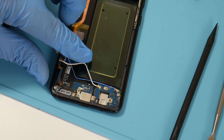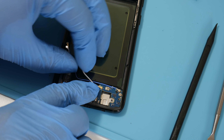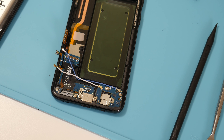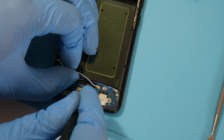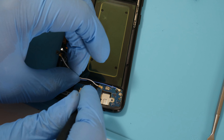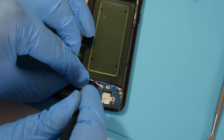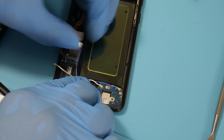Next, plug in the jumper cables — you have a blue and a white one. Push down gently and run them through towards the top. Keep these cables very organized and remember how they were before; you can take pictures for reference. Use your spudger to line them up, make sure they're nice and smooth, then slide this one towards the top.